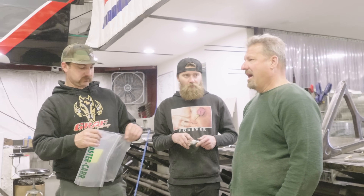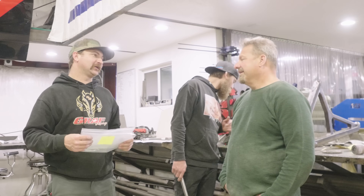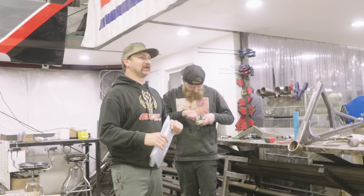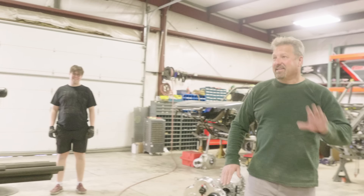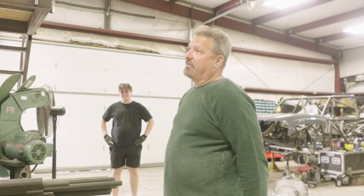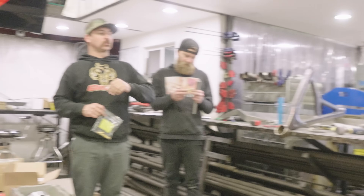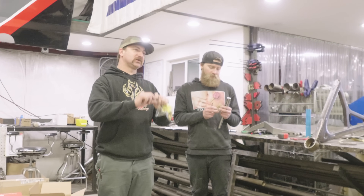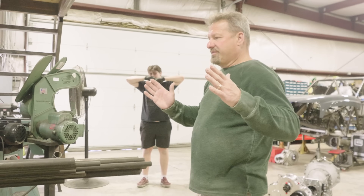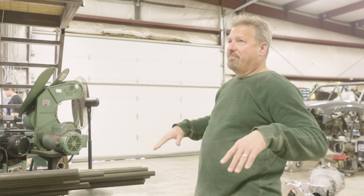That hood's not that great — it's thin in spots, thick in spots. Here we go again — you just talk it down so when it's the finished product it looks like Jesus did it. I tried to reinforce that center so it would be better, but it's thin as shit, dude. Do you think we should put like a rib underneath — like a diamond rib underneath? The center section's going to be good. It's where the fenders are that's the issue.